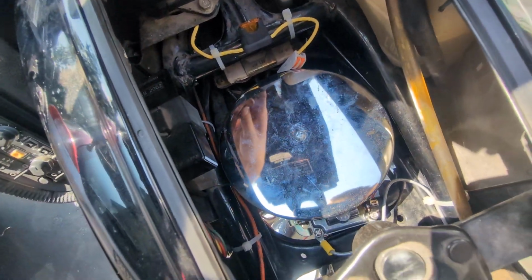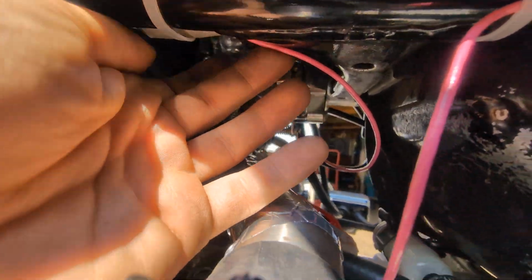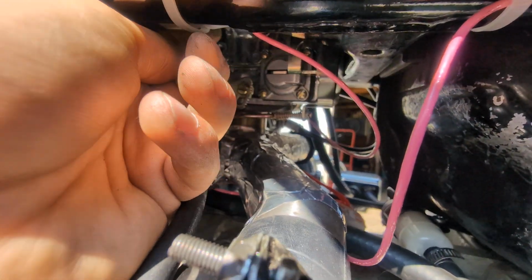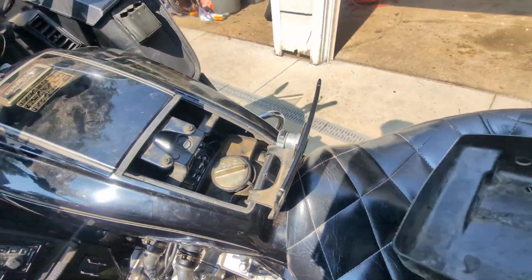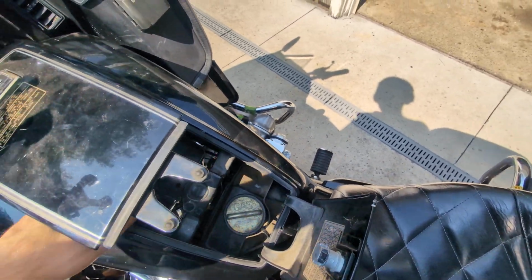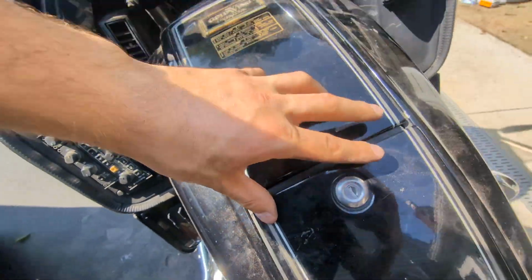Then to the carb, I changed the wiring a little bit. I actually wired them, come out of this Wago connector. I taped one up here. This goes to the fuel cutoff, and there's one that splits off and goes to the electric choke element. And then, yeah, if you get this air filter, this tray will fit in nicely. It'll wobble a little bit, but doesn't matter. And then watch this. Yeah, I have a spring for this, it's broken, but it just closes really nicely now.